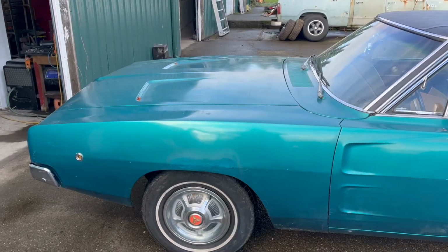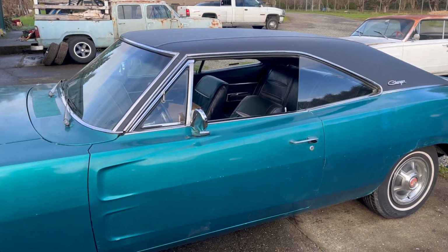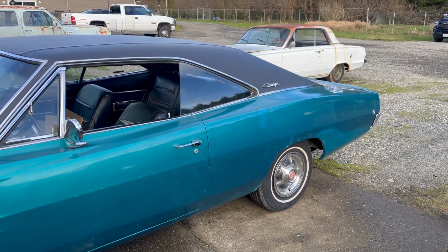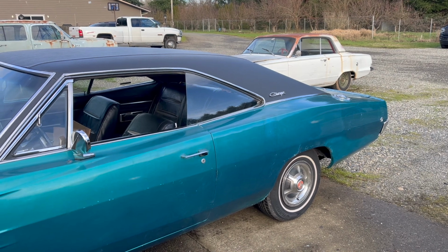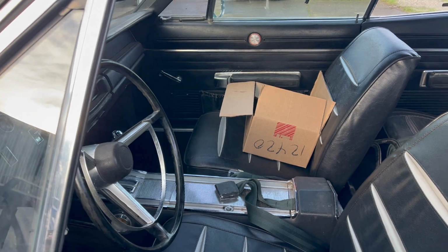It still pings. Haven't confirmed if the timing mark's right yet, which I do need to do. But I backed it off to 32 degrees by the mark, and it still pings, but it's much better. I'm gonna have Tom go dump some premium fuel in it, because it's definitely got cheap unleaded in the tank, and we'll see what that does. I predict not much.